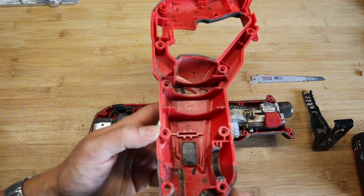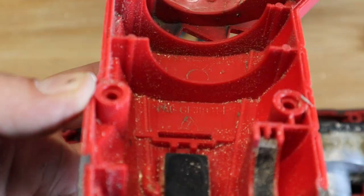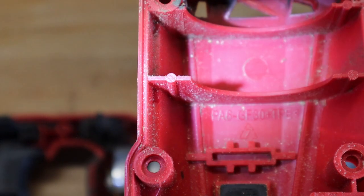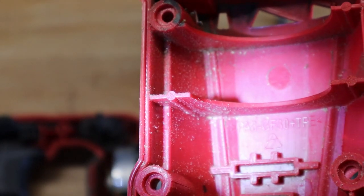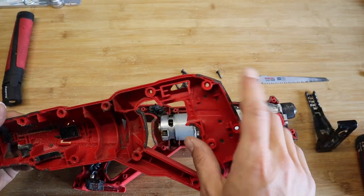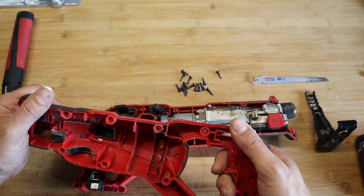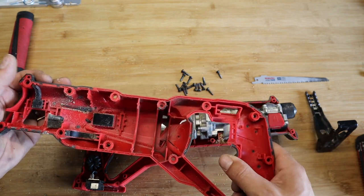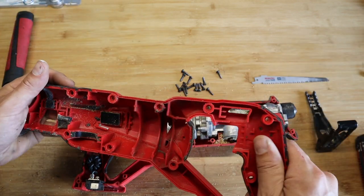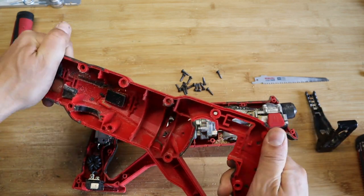The actual description is here — let's zoom in: PA-6 with 30% glass fibre reinforcement and a TPE overmoulding, as per the norm. The overmoulding — the black stuff — is nicely integrated into the base plastic housing of the tool, the clamshell as they call it, because it clams around the tool from both sides. I was about to say nice and stiff, but it's got quite a bit of flex to it — though you only ever use it in one direction anyway.